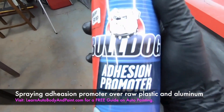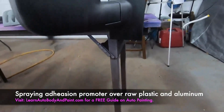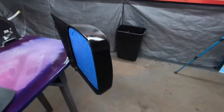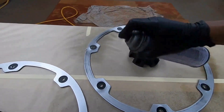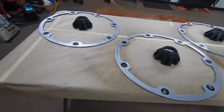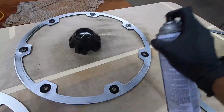As I say in my other VIP videos, if you want to get rid of the plastic texture in some plastic parts, you would 2k filler prime it, then sand it down flat with 400 grit, then paint it — and it'll look like a regular glossy body panel. But if you're not concerned about the porous paint texture on mirrors and bumper covers and just want to paint it, you could just spray some adhesion promoter on it and paint it.